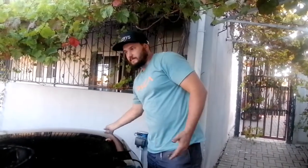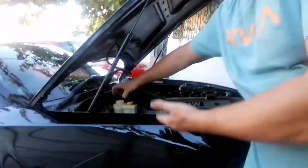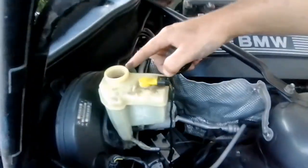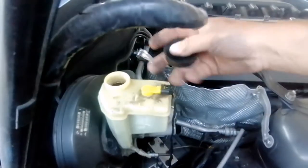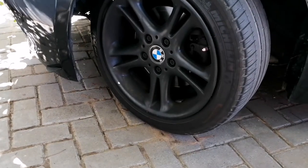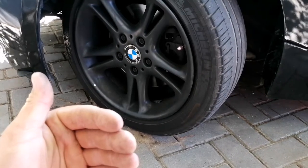We need to open our brake fluid reservoir, as we'll need to separate the pot from the pads because everything is worn and we'll need to get it to the open position. When we do this, a lot of the brake fluid will push back into the system. As you can see it's full here, so I'll need to take some of that out because it will overflow. First, turn your wheel all the way so that your caliper is as far out as possible.